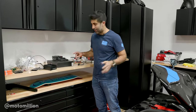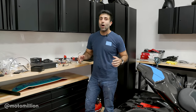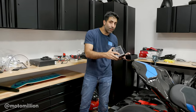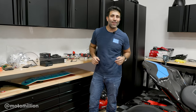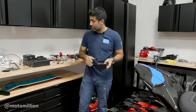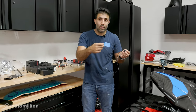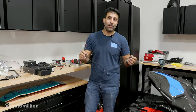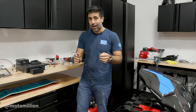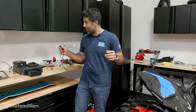Here are our mirrors and our turn signal kit. Just like every other video, all links to the parts we're using are in the description below. This is our Rizoma kit that makes everything plug-and-play for the S1000RR and M1000RR. To be honest, as a Ducati guy I've never installed this on a BMW yet — I've installed it on many Ducatis and know how it goes. These kits come with resistors; I don't know if I'll need them for this M1000RR. I mocked it up, the bracket goes on the fairing piece, and I'm going to wire it up without a resistor first to see if it hyperflashes or throws an error code saying the turn signals are missing. If it needs a resistor, we have it here. This install should be pretty straightforward.